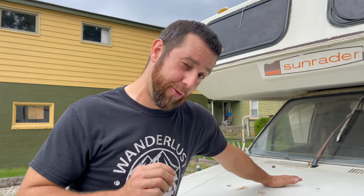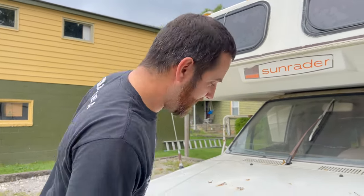Yeah. Sounds easy. So it's only, what, 6,000 pounds? Yeah, just shy. 5,800. Okay. Yeah, it's easy. Or 6,800. No big deal. We'll figure it out. Yeah, you got this. I have an idea. Instead of pushing this pile, why don't we just ride the starter, put it in gear, which is stuck in gear, actually, clutch don't work, and just crank, crank, crank. With a 4-speed transmission and a 307 rear end gear, this thing is going to be going like 20 miles an hour on the starter. If it works. I don't know if the engine seized or if the starter works.